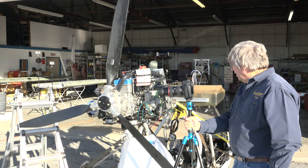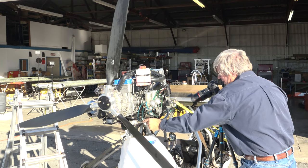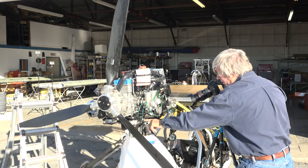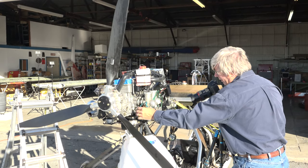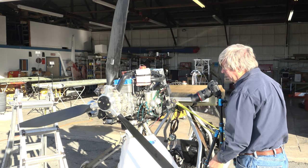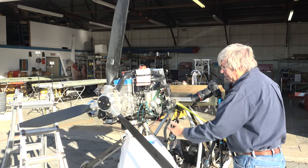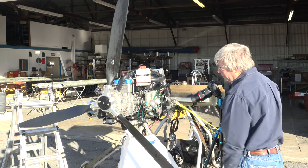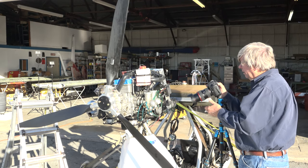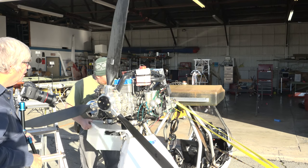Not a big fan of the plastic tees. Keep in mind this is the primer system, and I'm not a big fan of the primer system either. There isn't any reason at all that you need a primer system on an engine like this if you've got the chokes working correctly. The main reason primer systems get installed on airplanes is because owners don't know how to keep the choke system working correctly. But if any one of these lines crack or that plastic T breaks, it's guaranteed to fry that cylinder — too much air getting into the downwind side of the carburetor.